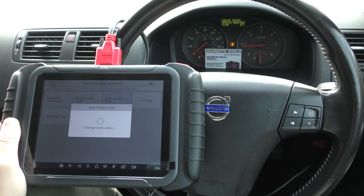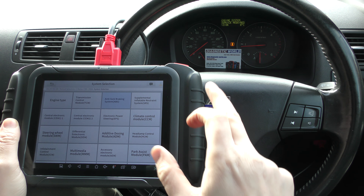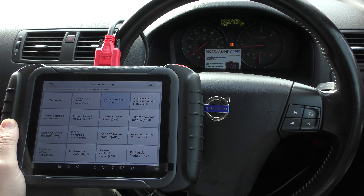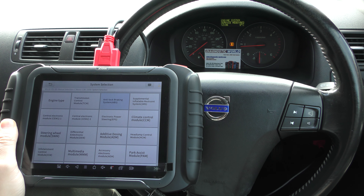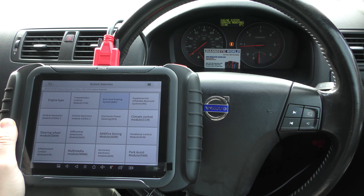Click yes to that, and after a few seconds we'll come out of this. That should remain steady — then another normal light comes on briefly, and then they'll both go off. The brake warning light came on momentarily and then they've both gone off, so again that's job done and the ABS warnings have all gone.